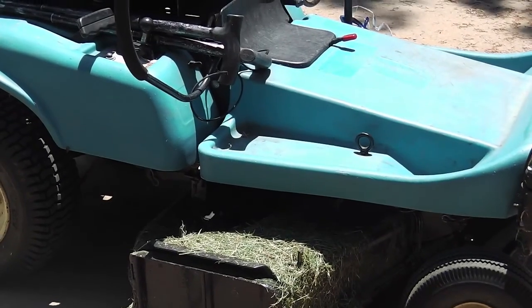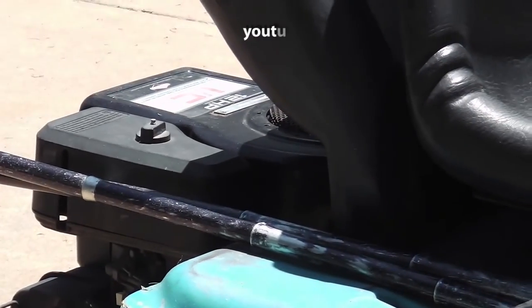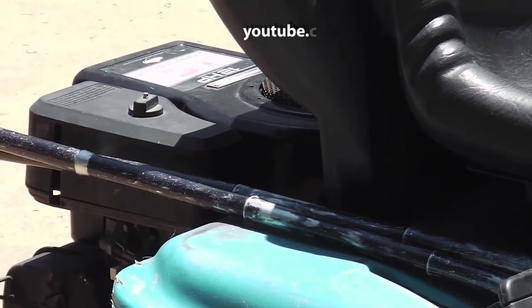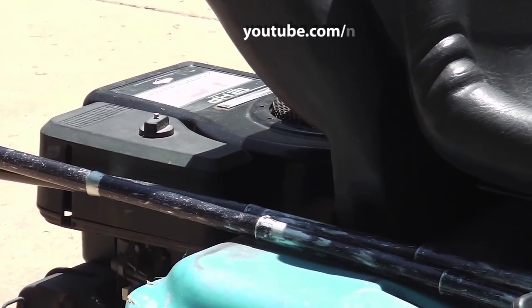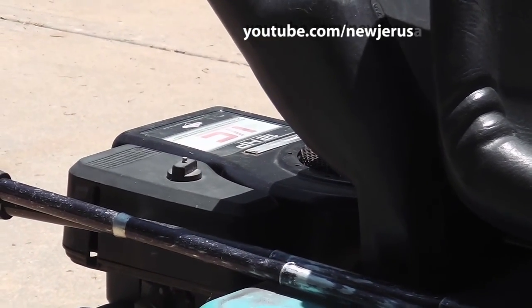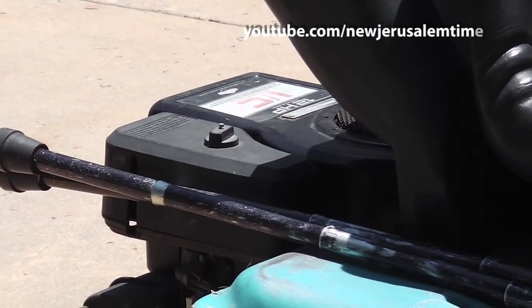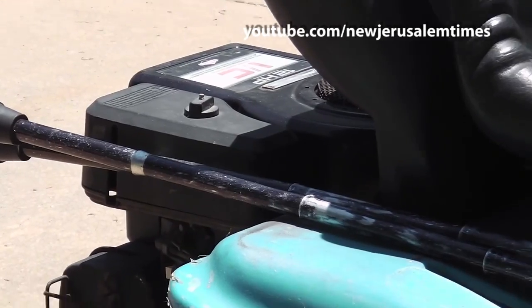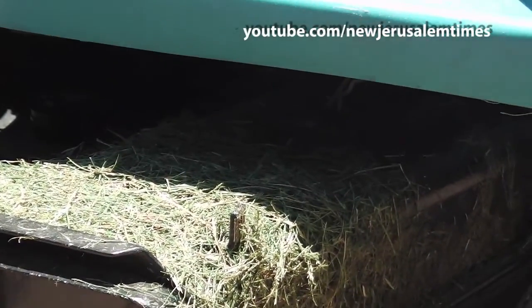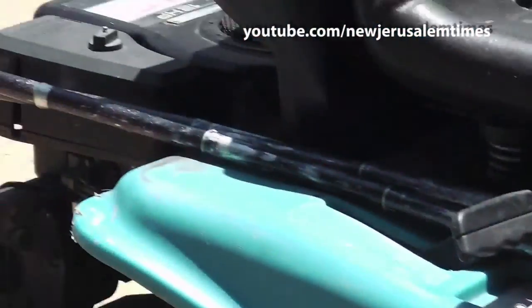They need a 9-amp alternator, and I don't know, you may be able to put a 9-amp alternator under that flywheel. It might be a full circle and not just a half moon, so maybe you can do it. But I believe all of the overhead valve, single cylinder, Intek Briggs motors do have an alternator that will put out the 9 amps, so you can put a deck on there and use an electronic clutch, and that would be an upgrade. So, it may be doable, but it may not. So there it is. If you want to try it, try it. You just might get lucky.